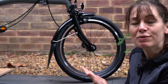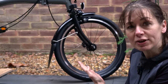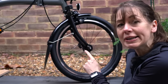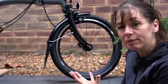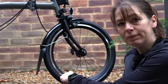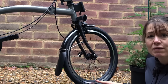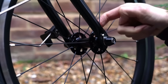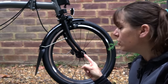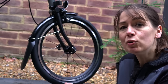The front wheel — wow, it's all new. It has 20 spokes designed to make them more lightweight. They're double-butted, meaning they're made of three sections of metal, so they're thinner in the middle and thicker at either end for additional strength. The profile of the rim is different — it's more aero, thinner and deeper. Because of the thinner rim profile, we have a Presta rather than a Schrader valve. It looks to us like it's the SV4 inner tube from Schwalbe. The hub and axle are redesigned; to save weight it is hollow with a bolt-through axle undone using an Allen key. You have a choice of tyres: the Schwalbe One Blacks or the Continental Contact Urbans.